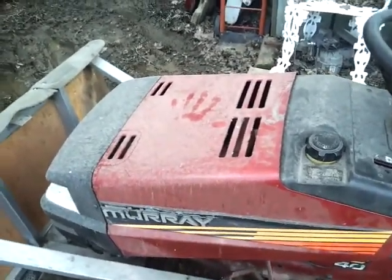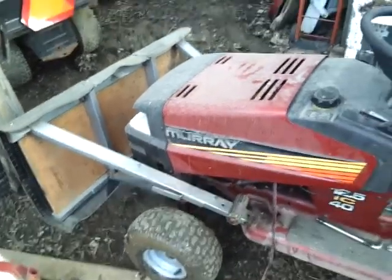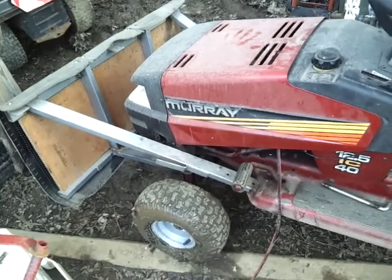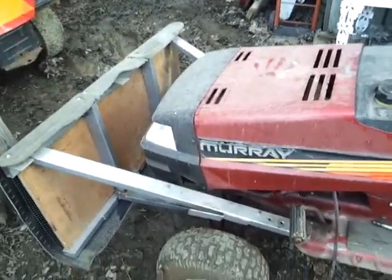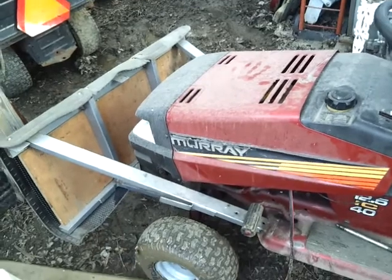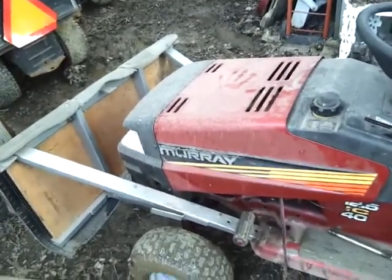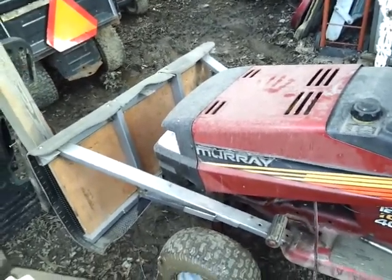I don't know how good it is now because it dumped some gas into the engine. When I put gas in it, it actually filled the carburetor, so the float was getting stuck. The reason why I couldn't rev it, I did leave it in the description, but I'll tell you now as well. I believe the float stuck, so every time I go to rev it, it dies. So it's not running 100% yet. They did drain the gas, but there was still a little bit of gas in the float.